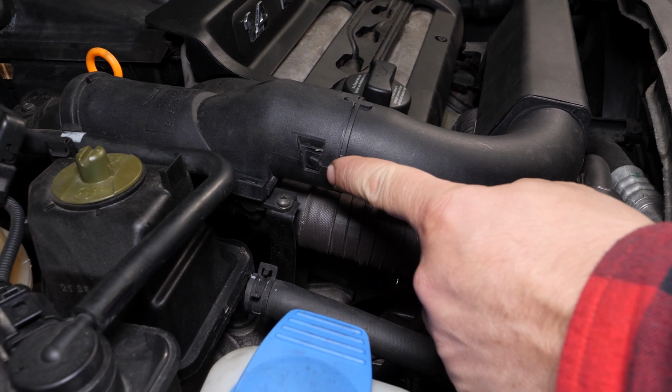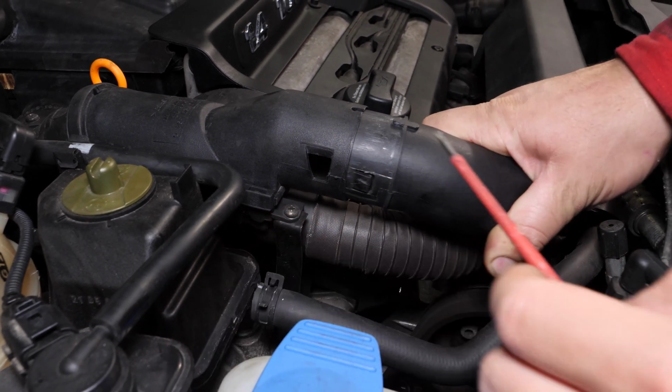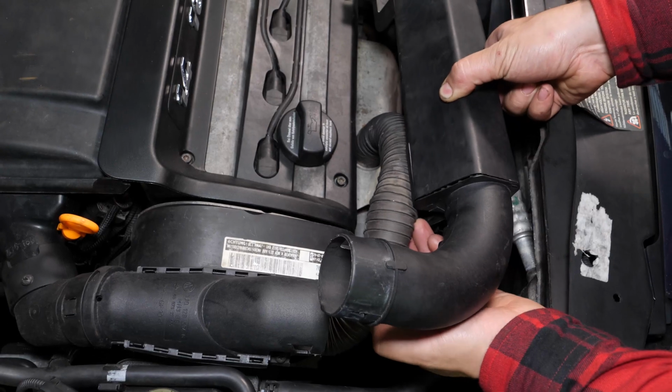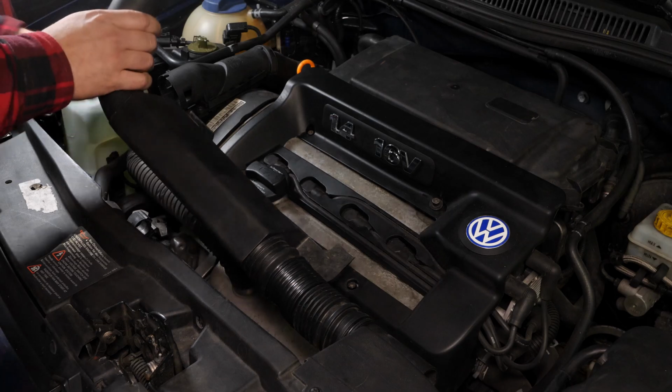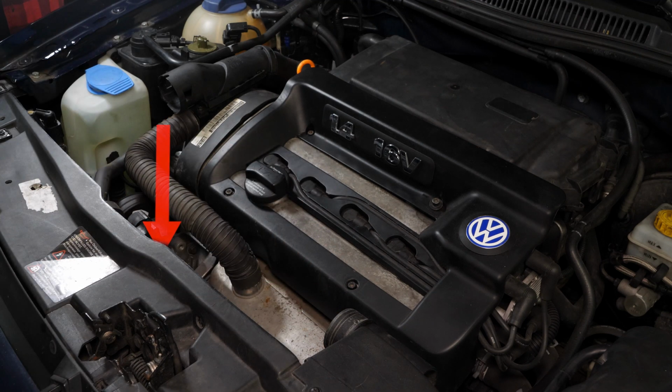With a small flathead screwdriver, push down on the holding spur for the conduit, then pull on it. Lift it up, making sure you remove the tube held on the hook located under the conduit. Finally, pull on the other end of the conduit. You can now see the oil filter.